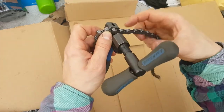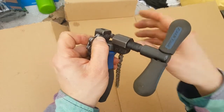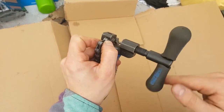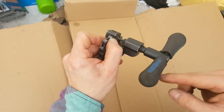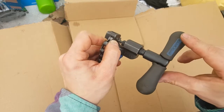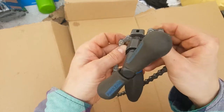So whatever tool you have, you make sure the chain is fitted snugly inside. You slowly bring the driving pin against the pin in the chain, making sure that it's nice and central.